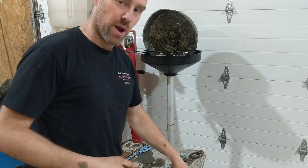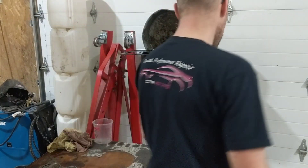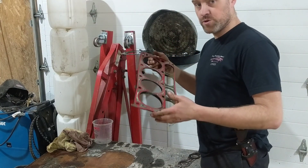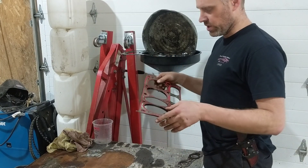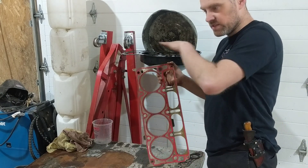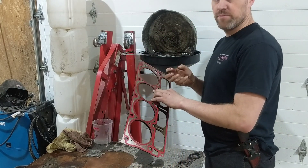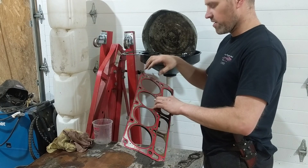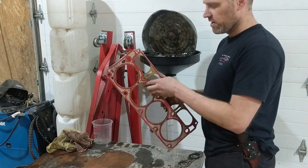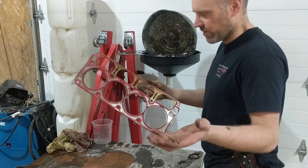Gasket preparation is critical — absolutely critical. With MLS head gaskets, you're going to want both machine surfaces to be as flat as possible. It's highly recommended that anytime you pull a cylinder head off, you have the heads decked to smooth out that surface and make sure it's good. Right around the bolt holes you're going to have manipulated metal because it's tighter there than the rest — the bolts are pulling down, squishing and distorting everything. So make sure you get the heads milled, and I always recommend a valve job if you have the cylinder heads off anyway, especially on GM vehicles.